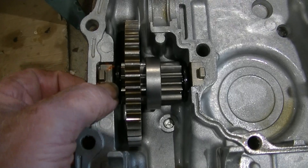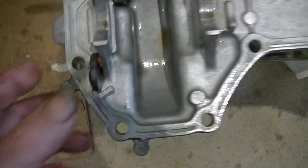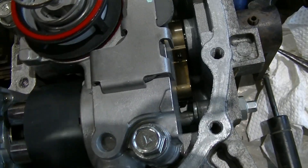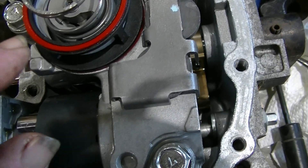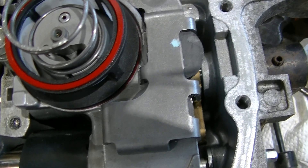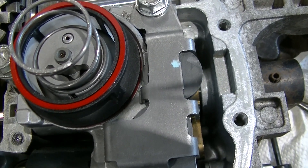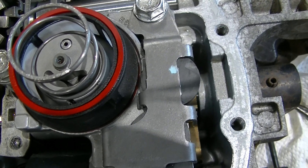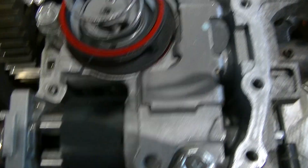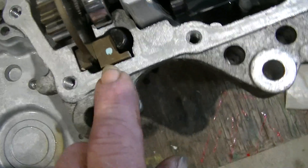One was a little keeper for this gear. That fell, the magnet fell, this spring, this filter. There are three parts to the oil pump: there's an internal gear inside, a small external gear, and there are dots on those to put them back in the proper relationship, the same as they were originally.